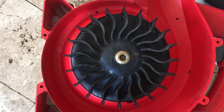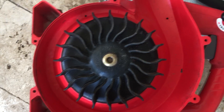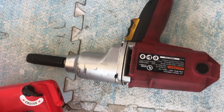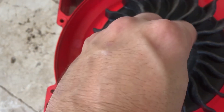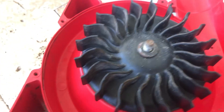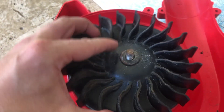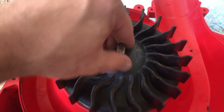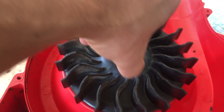When you pull the machine apart, it will expose the fan. Getting the main bolt off, I had to use an impact wrench. None of the videos online showed how to do this — it spins the turbine around. I figured out that I could step my shoe on the turbine and then use the impact driver to get the main nut off. It was 14 millimeters.